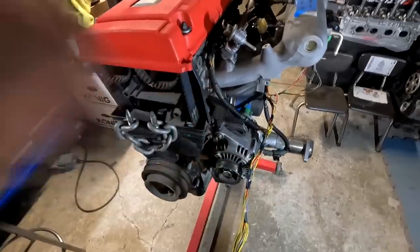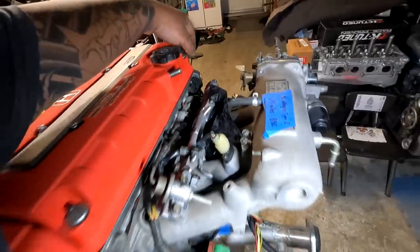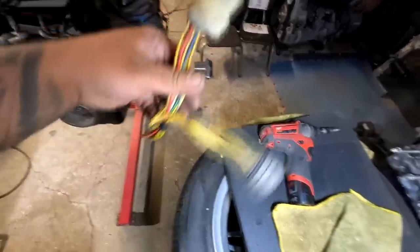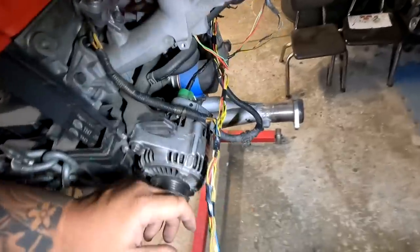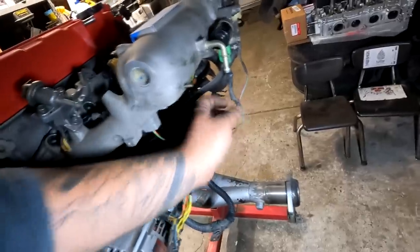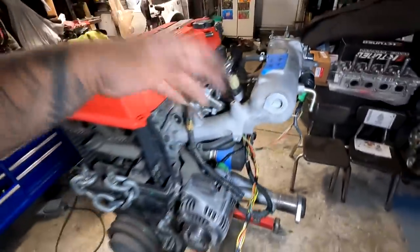I finished the harness a little while ago. I was helping my brother with his wagon and my cousin with his RAV4, so I pulled my Type R motor out of the corner to mock up the harness before I 100% loom it up. The harness is pretty much stripped down but all the modifications for the dual point to multi-point have already been done. I'm checking to make sure everything is reaching its home location. The harness is converted to full OBD1 — OBD1 injectors with the correct gray plugs, OBD1 distributor, and the OBD1 injector block-off for the resistor box since it doesn't use the resistor box.